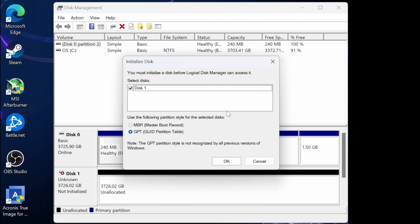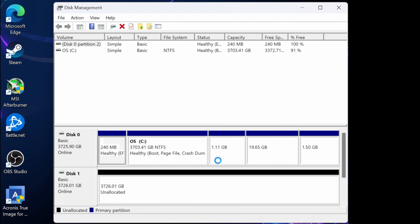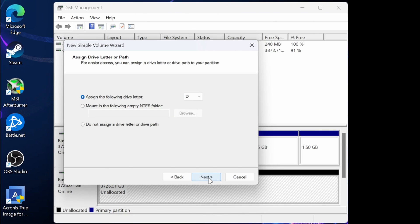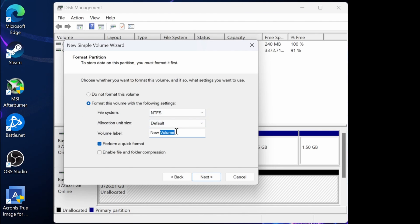For this laptop I'm doing a fresh install — I'll put a guide in the description for doing a fresh install on Lenovo or Dell laptops. You can also clone from the existing drive to the secondary drive; we've covered that in previous videos and I'll link it below. Either way it's a very simple process — with a fresh install it was up and running within about 20 minutes. Once your OS and drivers are installed, if you've added a secondary drive, go into Disk Management, initialize, and format that drive to get full access to it. I'm using the P3 Plus 4TB single-sided as a cool-running games drive.